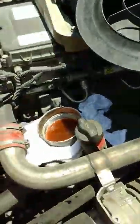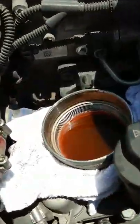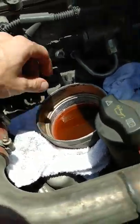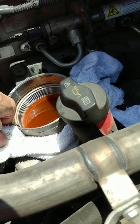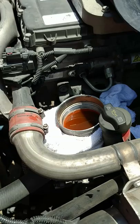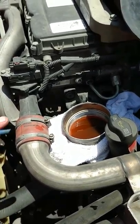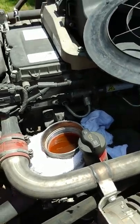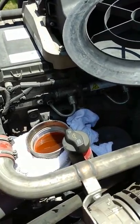What I'm going to do is vacuum-clean the housing and then hopefully that fixes the problem. At idle it was running cooler than normal — less than 200 degrees — and at about 14 PSI. On a steep hill it would start to warm up, not overheat, but warm up.